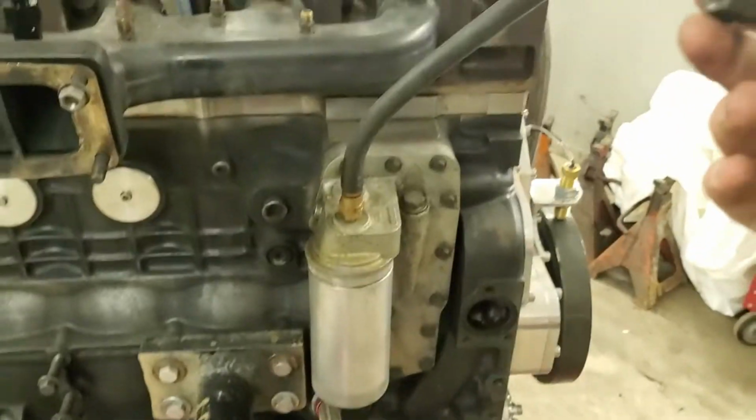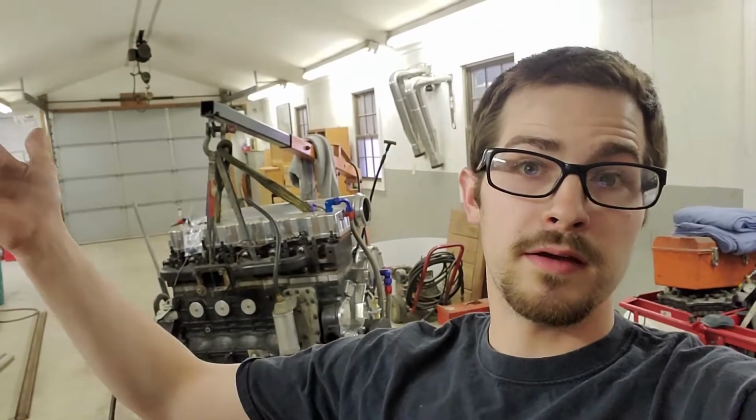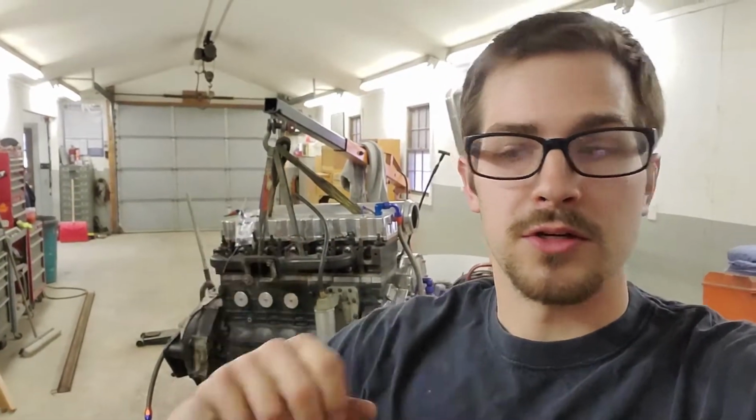So when I bought this motor, it came with this press fitting on it. These are rated for 2,000 PSI. They're not the prettiest, they're not AN, but at this point I had that one over there failing cost me a turbo. This one hasn't broken, so instead I'm just gonna let it run with that one.